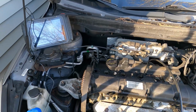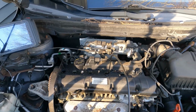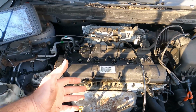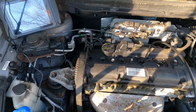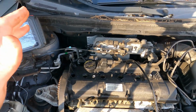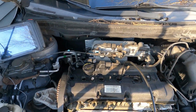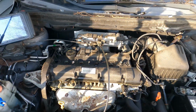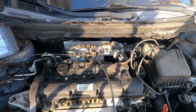So we're going to skip the timing belt. We're not going to worry about throwing one on there yet. We're going to work on ripping this cylinder head off, and they're actually pretty easy to pull. We're going to unbolt the exhaust manifold. You just kind of pull it back a little bit. And we're going to leave the intake manifold on. We're going to obviously take all the accessories off of it. We just have 2 support rods back there to unbolt, and we'll pull the intake off with the head attached to it and then separate them at that point.